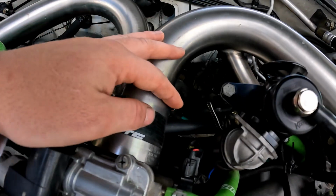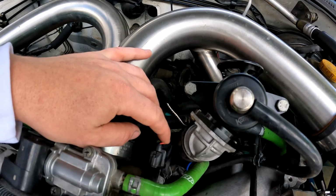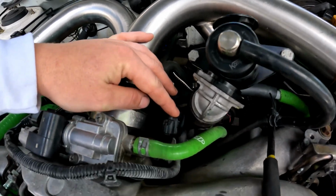Alright, so as you can see, we had a few issues. Since then, we fixed them. One being that the gasket or O-ring or something was leaking. I basically re-lubed it, put some sticky shit on the gasket, and since then, it's gotten better. One other problem we had that was starting to misfire was this clamp here was rubbing on these wires to the throttle position sensor, and it was freaking out. And it died and wouldn't start, and I couldn't figure it out and finally noticed that on the side of the road.